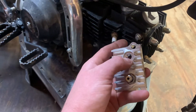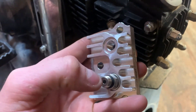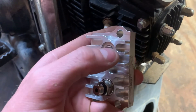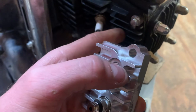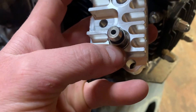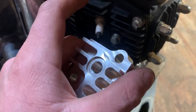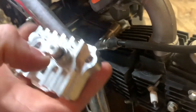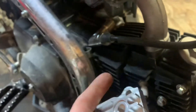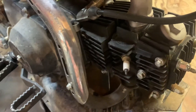I'm going to only utilize one of these to pressurize oil to the turbocharger and block off this one. The reason is I want as much oil pressure going to the turbo and to the camshaft at the same time as I can possibly get. Blocking this off will keep the oil pressurized in the top end right here. The oil feedback drain for the turbocharger I'm going to dump somewhere into the case — probably drill a hole somewhere over here — and tap a fitting in there and restrict the fitting, so oil pressure stays up for the camshaft and the turbo.